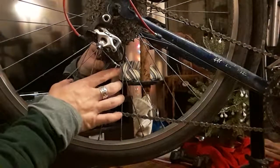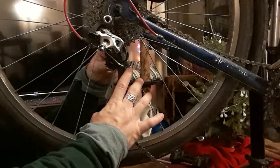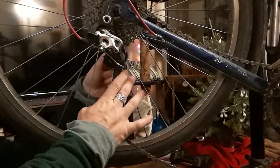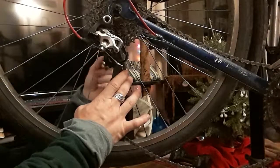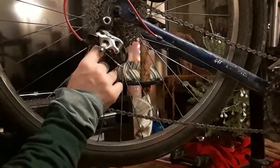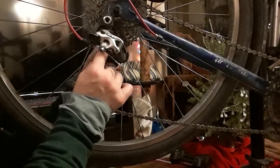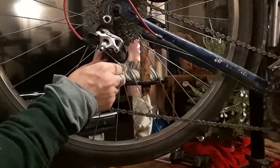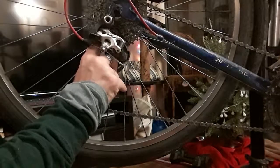First, I'll get the right size of Allen wrench. Just pop that baby off. There's a little bit of difficulty where you just have to align the spokes right, and if your multi-tool has a particularly short arm for an Allen wrench, this will be particularly difficult. Now, note, all this is under tension, so as I do this, I want to hold tension with my hand so as to minimize how much stuff wants to go flying all around.